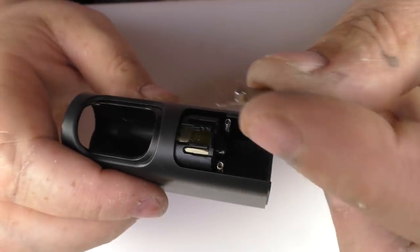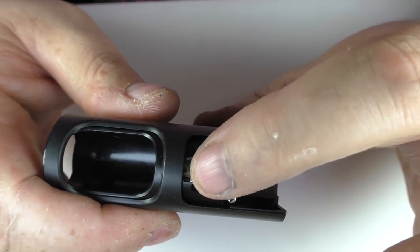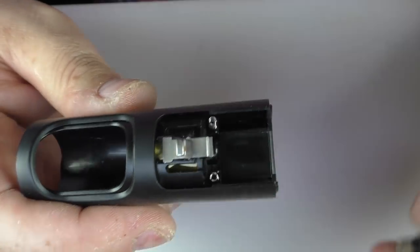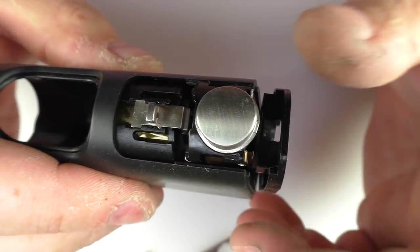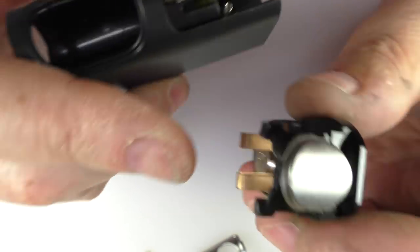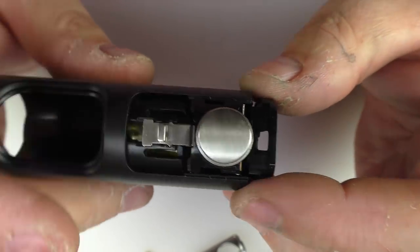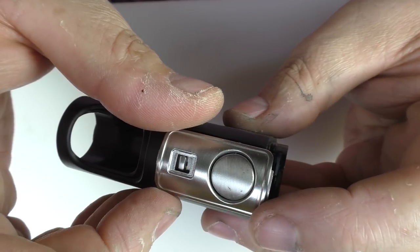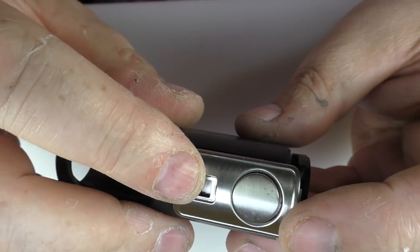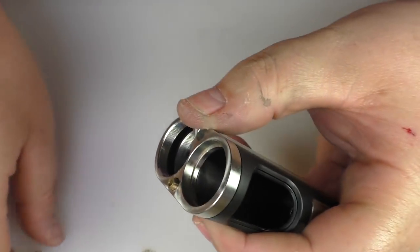So now that that's in, I'm just going to take this piece and slot that in there. You will have to push down on this to get it past each bar here — slide that in, push down again and up she goes. And that's pretty much bang on. Then you want to take your lock for your switch and just set that in there. We're then going to put the top switch back in place. Make sure the lugs here are actually sitting on top of those springs so that when it drops back together those little springs are behind the switch — you don't want them getting trapped or pinned. Take your cover and place it over the switch, kind of like dropping it into place. Click — and that's the top plate back on. Just put the bottom cap back on, drop the screws in and tighten it all back up together.